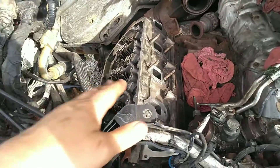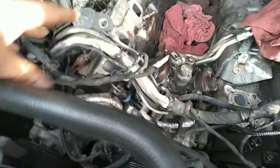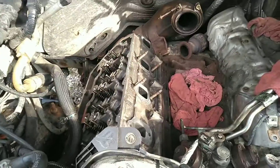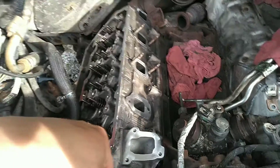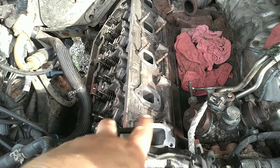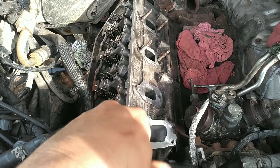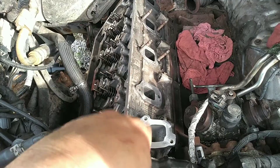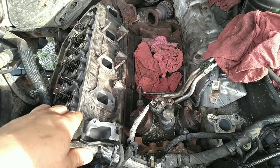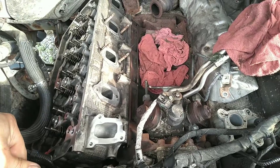If it was me, I would have put a camshaft in this thing — definitely would have pulled the front clip and pulled the cam out. I'm not real worried about putting the used lifters, but I would have gone with new push rods. Putting used rocker assemblies in there — I inspect them and they look good. These trucks are getting older; it's a 2011. I'd prefer to put all new stuff in there, but sometimes that's not always in people's budget — I understand that.